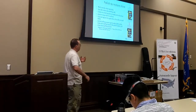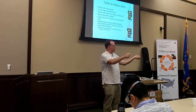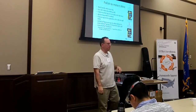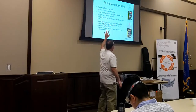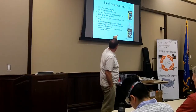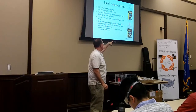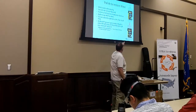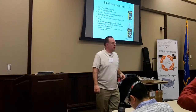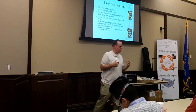Once you deem the wet sanding finished — no more speckly orange-peel texture visible under raking light, everything uniformly dull — then it's a matter of bringing the shine back. My go-to products are Meguiar's Mirror Glaze: Fine Cut Cleaner number 2, and then Mirror Glaze number 9. They have a whole product line with a color indicator showing how much abrasive is suspended in the liquid. Use old t-shirts — cut from the back panel so there's no ink. The softer the shirt the better.